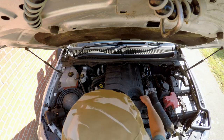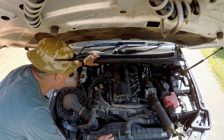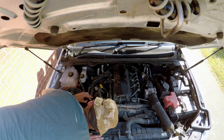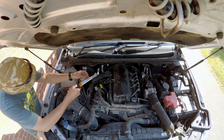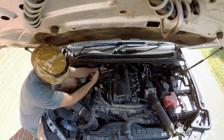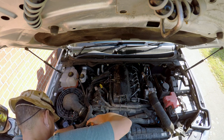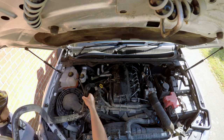Okay, here we go. First things first, remove that engine cover, laying that wonderful inline five cylinder 3.2 litre bare for all to see. As you can see I'm removing some of the clips from the pipes. It's pretty straightforward — the only tool you need is grippers just to get onto the clamps, loosen the pipe, give it a wiggle and out it pops.